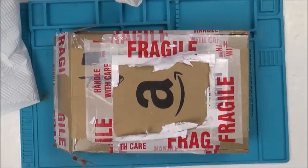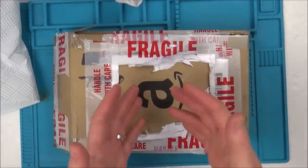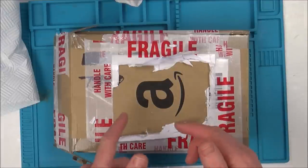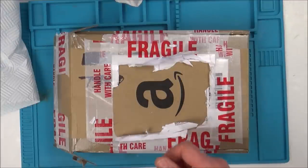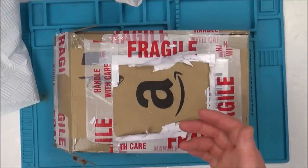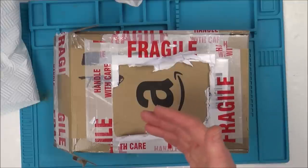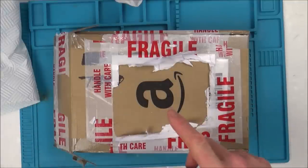In which case, there's a chance I may be able to get this to work by possibly just getting a tweezer and moving things around in a USB port. Although the proper fix-it people out there won't like that because I haven't replaced the port, I think that would be quite a realistic fault to fix, because numerous people are going to have kids, or not kids, adults as well, shoving things in there, maybe the incorrect lead or something, and then the pins might get damaged, or you might throw it in your rucksack and something might have jammed up into the port.